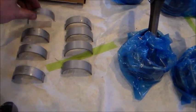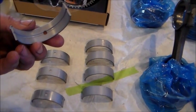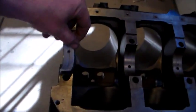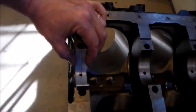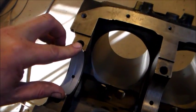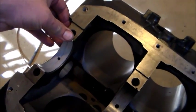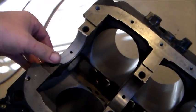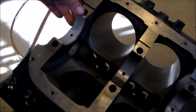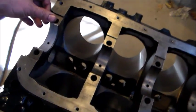You'll notice that the other bearing has no hole in it — that's the bottom bearing. The upper bearings have a groove and a hole that correspond with the upper part of the block. I get the bearing lined up over here on this end and then roll it in with the tang. I feel to make sure it's flush on both sides. I like to do this stuff with my fingers because you don't want any burring or marring that could have a negative effect on your crankshaft.